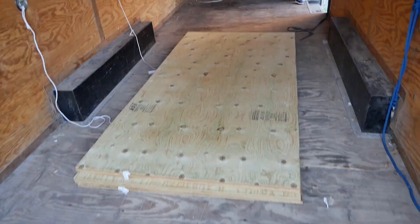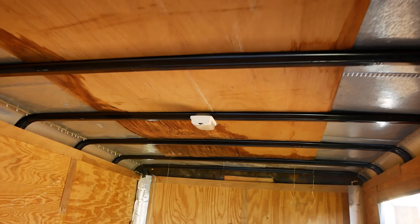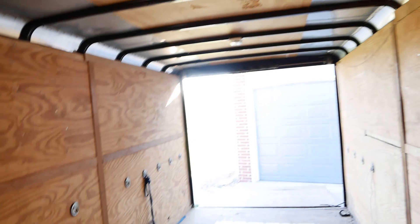Looking inside here, you can see it's not the best condition. There's some trim pieces missing, things like that. There was a little bit of a leak coming through in the ceiling right here, and there's another leak — this has been sealed up for the most part right here, but there's a little bit of daylight coming through, you can see on my hand. There's another leak up here but we know where it's coming from. I'm going to go ahead and patch those up, fill them with some silicone.